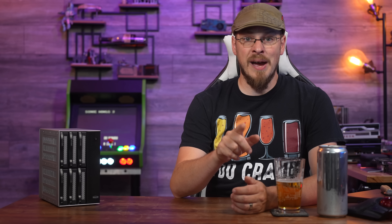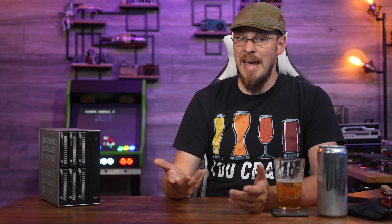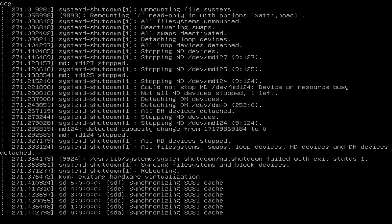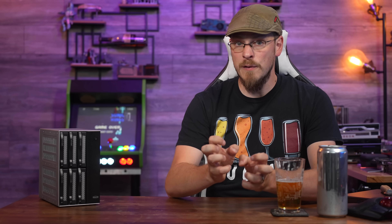So I enabled them for the fourth time, and this time manually selected them as the boot device without rebooting the system. And I was greeted with TrueNAS firing up. While TrueNAS ran about as well as you'd expect for having a Celeron N5095 and 32 gigabytes of memory, as soon as I rebooted, right back to Terra OS on the eMMC. I tried just about everything I could think of to make this setting stick — from creating user profiles, resetting CMOS manually, disabling the eMMC as a boot device — there was absolutely nothing I could do to get TerraMaster's hooks out of this AMI BIOS.